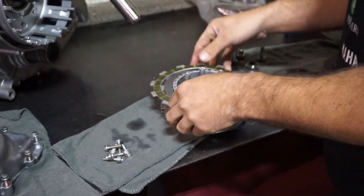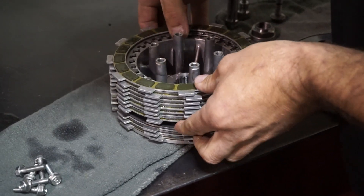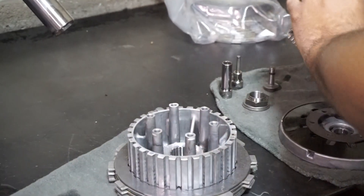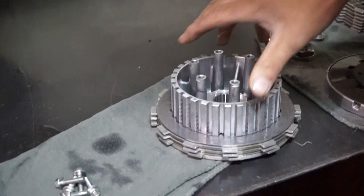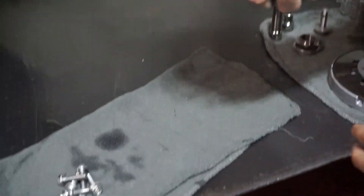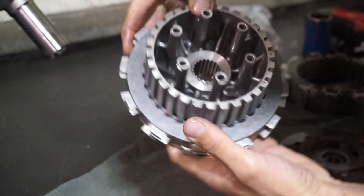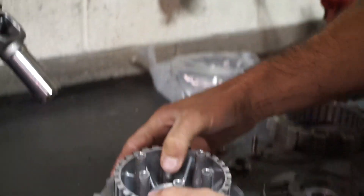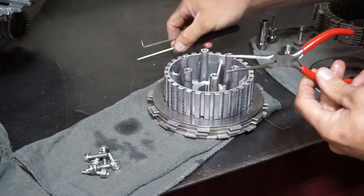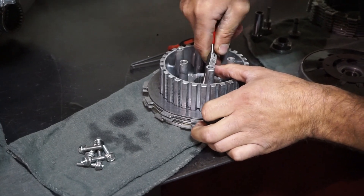So I'm going to put this tranny aside. Once you have it on the bench and you're going to replace it, pretty much three quarters down you can just pull them all off. We're working with a brand new clutch we've already been messing with — we reinstalled it, so we're going to put that one back on. Now this is where it gets tough — if you're doing it in the car this is where it would get tough, which is why we do it on the bench. You can see this plate won't come off — it's stuck on there. If you look closely, there's a wire ring all the way around here, and there are a couple of clips in here that hold it. We have a couple of pick tools and needle-nose pliers. Sometimes it's easier to get from the inside and push it out.